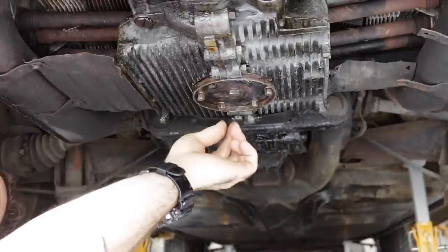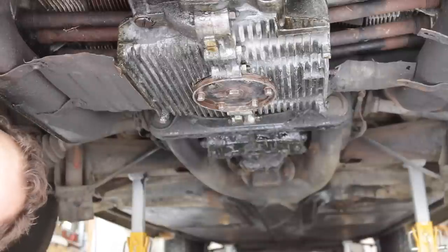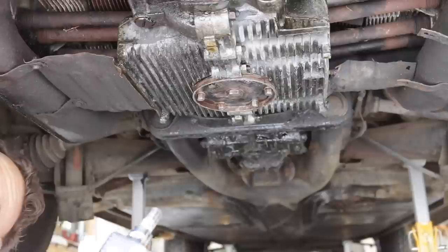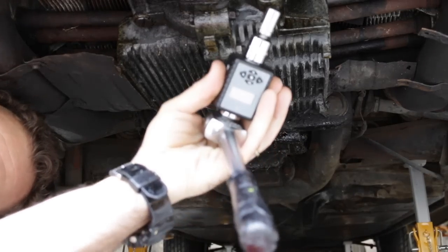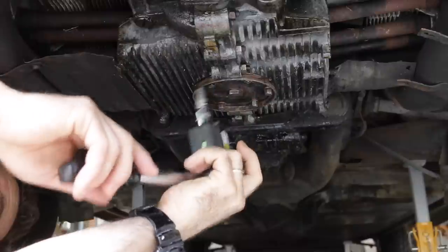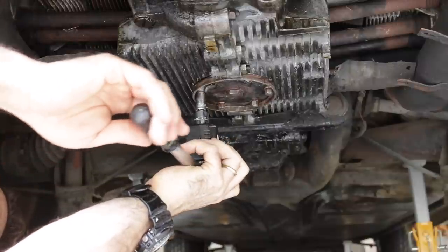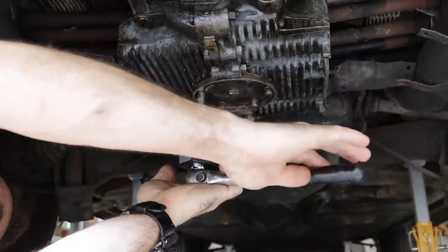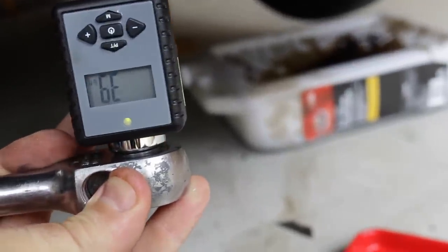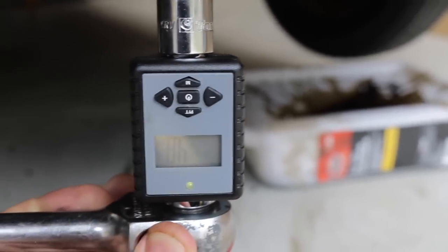So now I've got these all loosely done up, I have to torque them up to spec. The torque spec is actually tiny — it's just five foot pounds — and I don't have a torque wrench that will get to that. But I have this adapter which goes onto any socket; the lowest I can set it is seven and a half foot pounds, but it does read the torque setting out as I'm turning it, so I can just watch the screen and hopefully just get it to five foot pounds and then stop. I'll demonstrate on this exhaust bolt here — you can see as I put the pressure on it gives me a torque setting, then I take it off and it starts again.